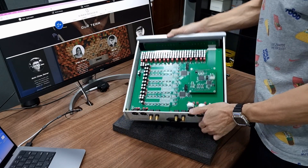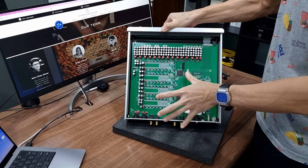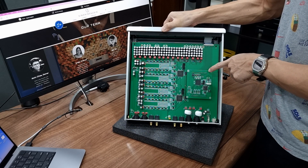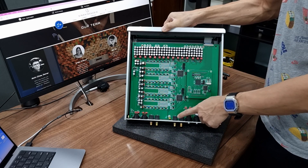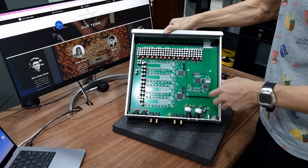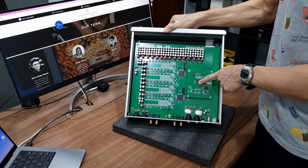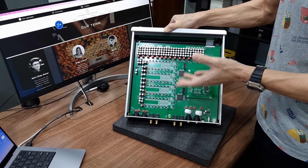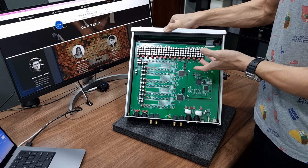Under the hood you'll see a big piece of PCB — printed circuit board — and it comprises another module right over here. This is the DSP module, the Digital Signal Processing module, where it processes all the digital input signal connections from the upstream. And there's this FPGA here — a field-programmable gate array — that processes the digital signal. It goes through the filter settings, the slow filter and sharp filter, before buffering and re-clocking.